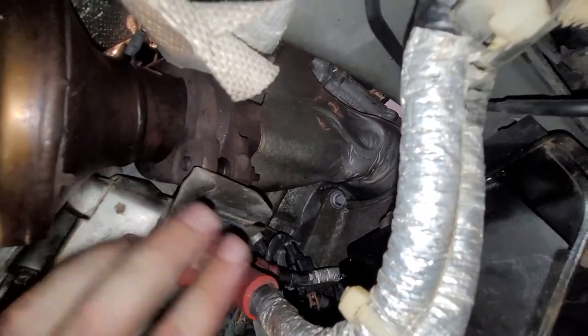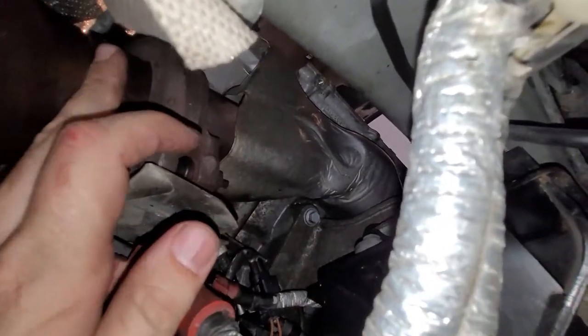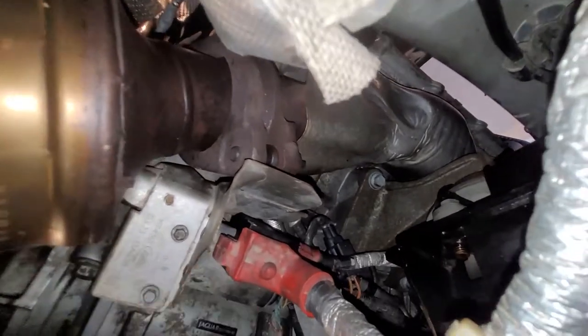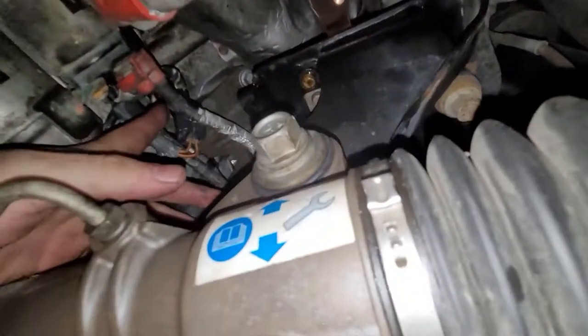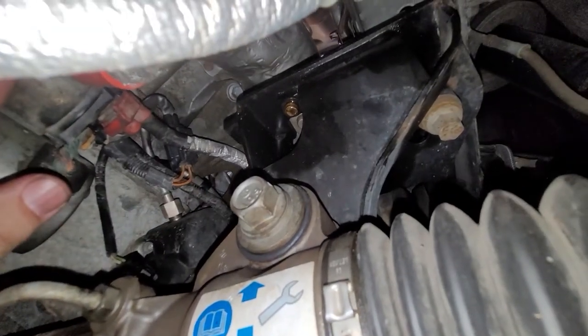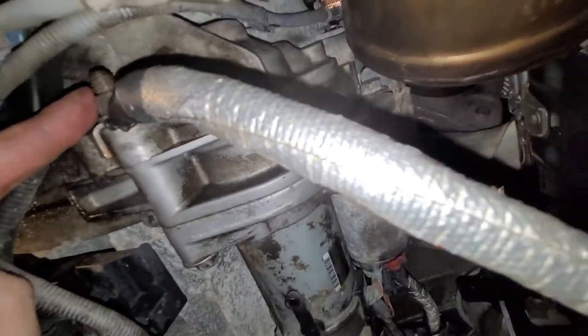Exhaust, it's two bolts here. You got a 15 millimeter nut on the back side over here, and a 15 millimeter nut on the top side. I don't know, you're not going to be able to see it. Anyway, so the exhaust goes on, and then the starter will go back on. You have the alternator lead wire coming back here, the main battery positive coming here, and the main battery negative coming over here.